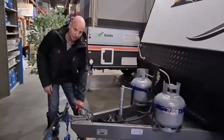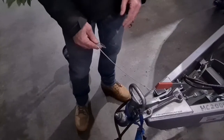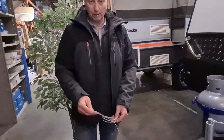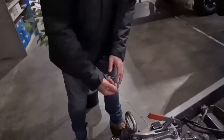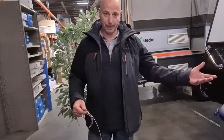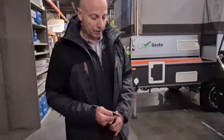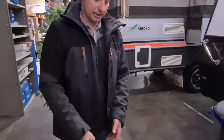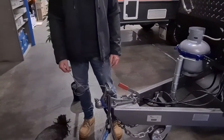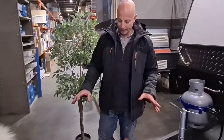Next we've got this little black box — that's the switch for the breakaway system. The breakaway system is designed to apply the caravan's brakes if the car and the caravan separate. This cable here needs to be attached to the car somewhere — generally there isn't a special place for it, so we put it on one of the shackles. If the car and the caravan separate, the logic is that pin will pull out, and when that's pulled out, the caravan's brakes will be applied from the caravan's battery. I generally put the cable through the handle up the top just to stop it dragging on the road and getting caught. Never ever pull it out — it just pushes back in if it does.